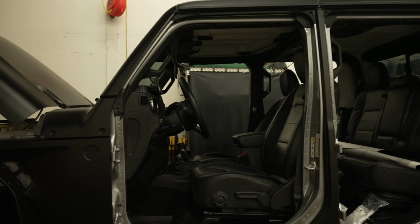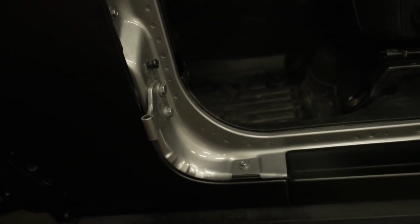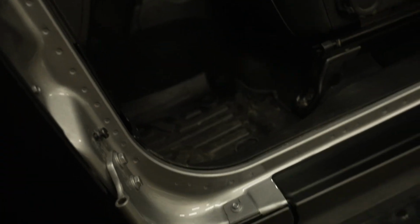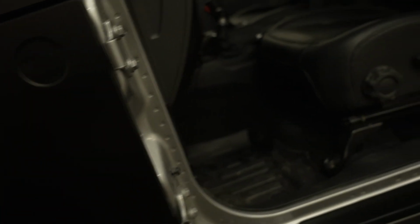I could probably give you an example a little bit later. I got to clean up some overspray that's actually on the silver paint, and all I'm going to be using is some isopropyl alcohol and a microfiber rag, and it's going to clean up just nice. So that's why I don't go crazy with masking and a lot of stuff. I'm only covering up the wrap because the wrap is more chemically sensitive.